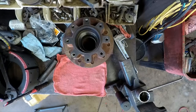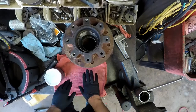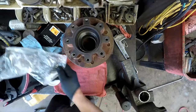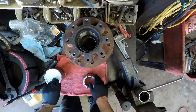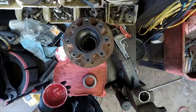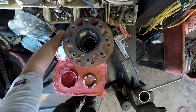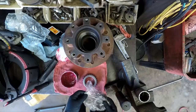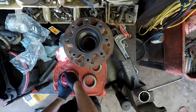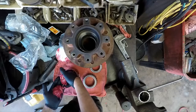From what I understand, Dexter is okay with you changing these over to grease, because they've had so many seal failures. That was the first thing that happened right after I bought this trailer — this thing would throw a wheel seal. I'm going to go ahead and pack the inner and the outer, get them both ready. Got some good old gooey wheel bearing grease.